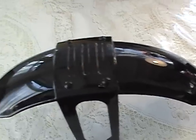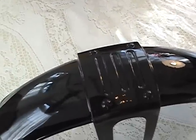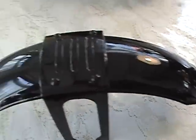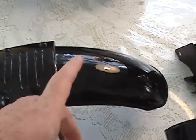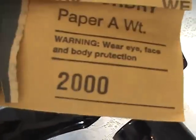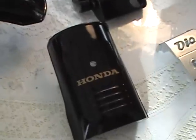I was just about ready to polish it and I said, well, I'll just shoot it. I had a little tiny bit of fish eyes in the coat — for some reason, probably because I had some wax residue on there. But I'm going to sand this down with 1200 grit right here, or 2000, and go at it again.